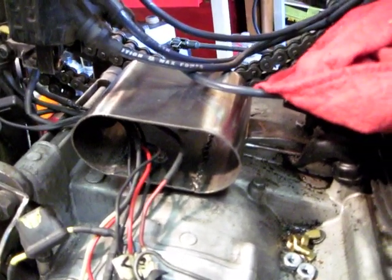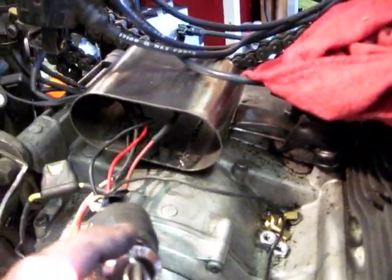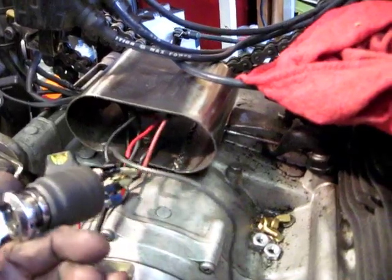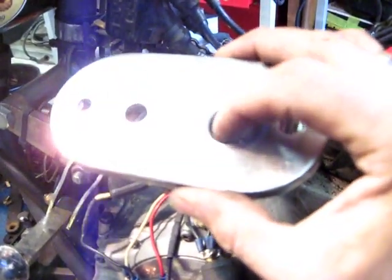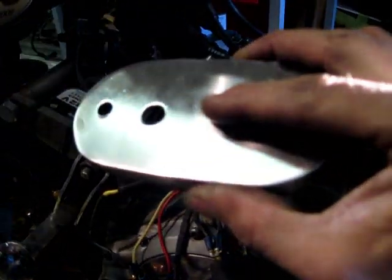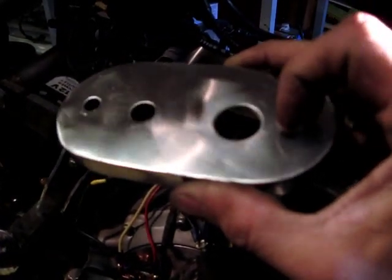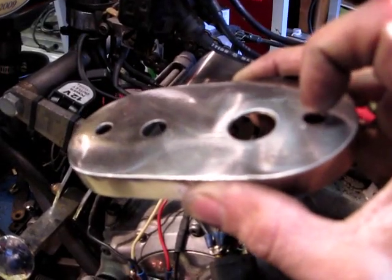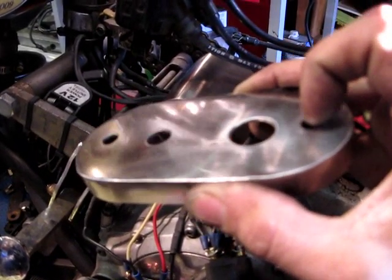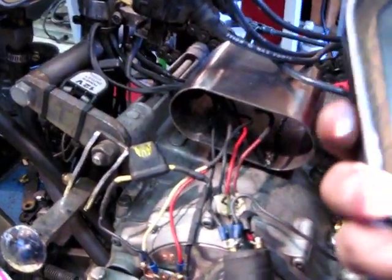That's all there is to it. This outside ring that holds the key switch on — when you drill your hole, you want to make sure it's over far enough that the wing nut clears that housing. If there's not enough room for the key switch you're using, put a couple washers underneath the bolt for the wing nut to raise it out so that it clears that escutcheon. That should be all there is to it.